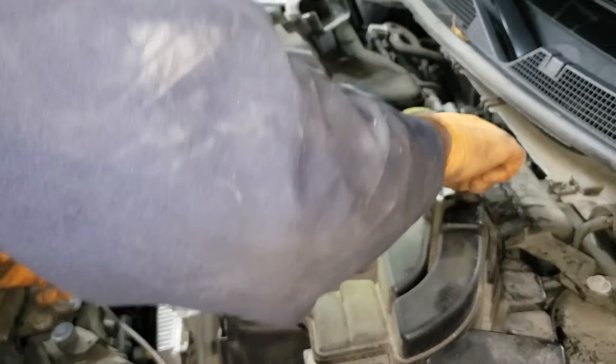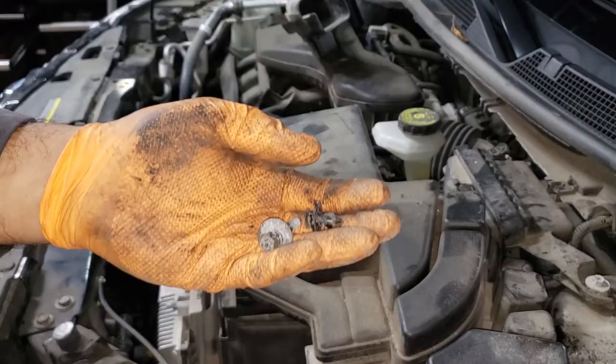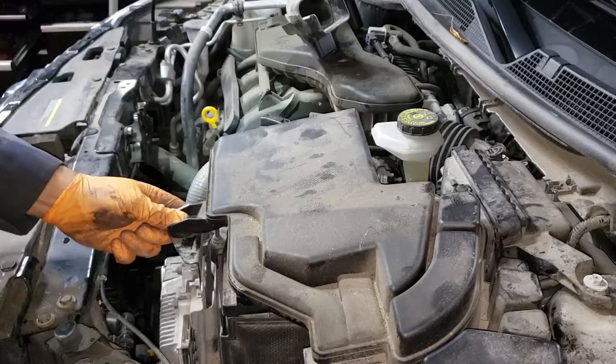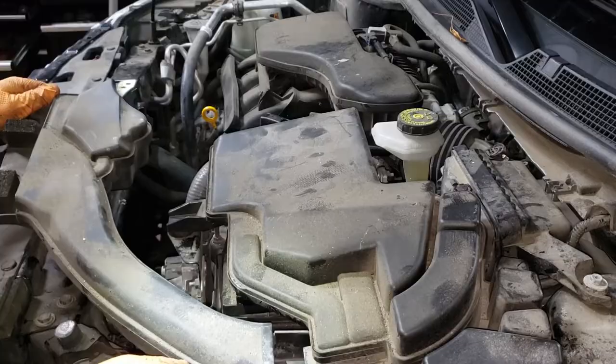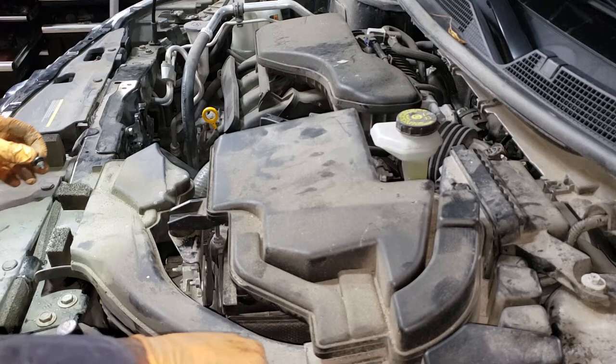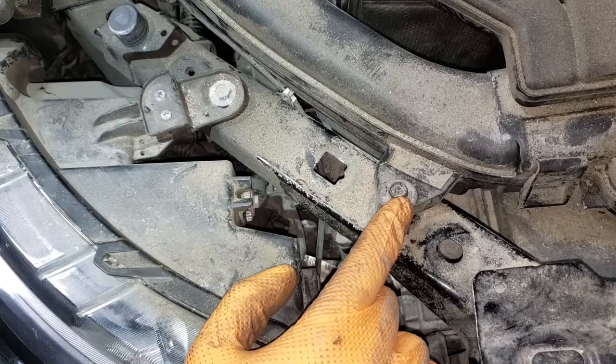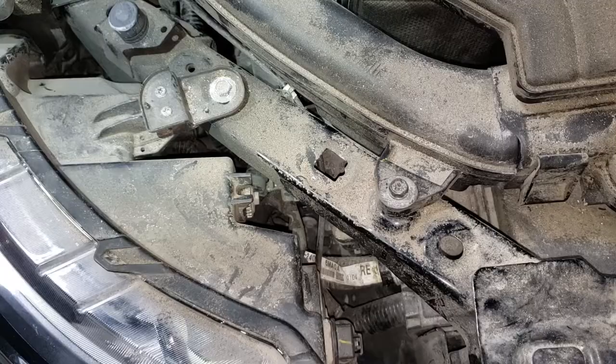Move the hardware off the battery before putting the cover back. Make sure the cover clips in properly. Put the 10-mil and the clip back in. With all your clips back in place, tighten down the battery terminal — it's a 10-mil, so snug, no more than about 8 foot-pounds is plenty. That's pretty much it — all we need to do now is top the cooling system up with coolant and we're good to go.